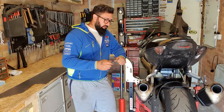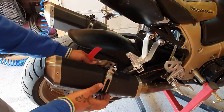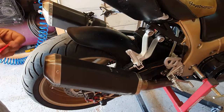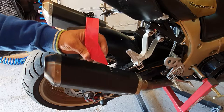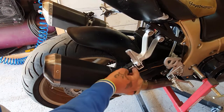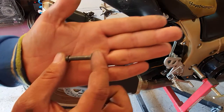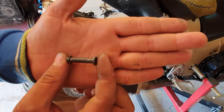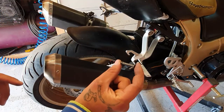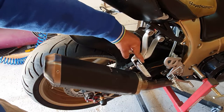I kept on thinking and I came up with an idea I think you're gonna like. I've done away with this little flimsy bracket altogether and came up with the idea of a little bracket that will bolt on. There's a bolt in there instead of the little pin that goes through with a circlip. This is the original piece that comes on the footpegs to hold the actual peg. I removed this piece and placed a M6 shouldered bolt and it's just perfect.